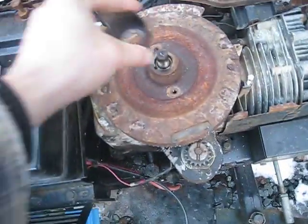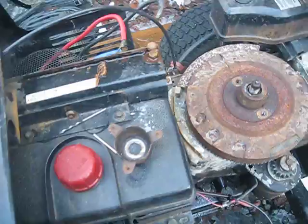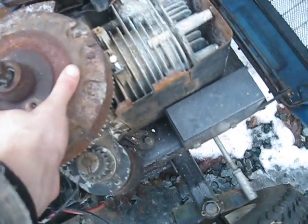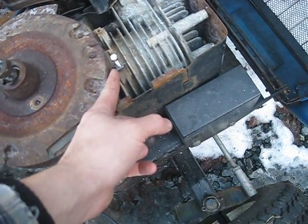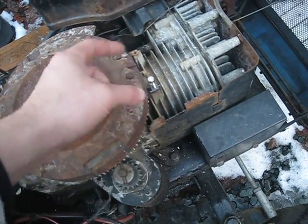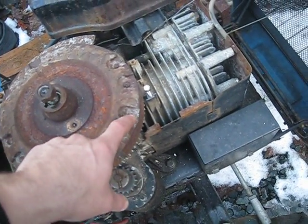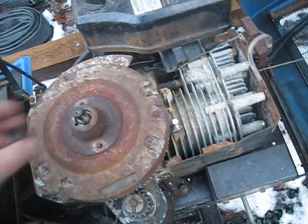All you have to do is take off the stock screen holder. Piece of advice: don't try to get your flywheel nut off by jamming something up against the coil — that's what I tried. I tried using a flat spot and wedging something through to stop the flywheel from moving. I was using a ratchet on the nut and it ended up moving the coil out, so I had to loosen the bolt, which broke. Then I tried to drill it, the drill bit went off center, and I ended up having to bore it out with a die grinder. Then I JB welded this bolt in here to use it as a stud, so I'll let that set up — I just did that a couple hours ago.